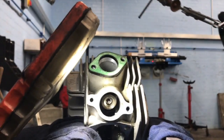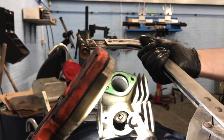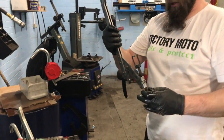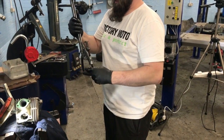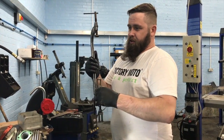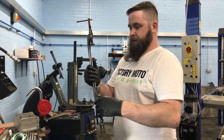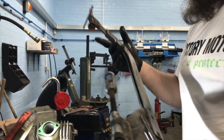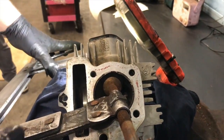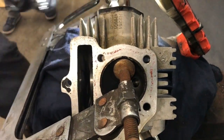Right, where's that valve spring? Oh, look at that. It goes in. That's it. It's in, so that's going to work. This is a valve spring compressing tool. Any automotive place will have one of these. Well, not most modern places, most places only fit tyres and exhausts. But this is for changing valve guides and valve stem seals, or when you're doing cylinder head work, if someone broke a cam belt, you'd pull all this apart with this and then fit new valves. So let's see if this will go small enough to get in here, because it might not. The tool will go into the face of the valve there, so you just make sure you get it straight. Then you clamp like that, and if you come back around there, Steph, you'll see the two collets.